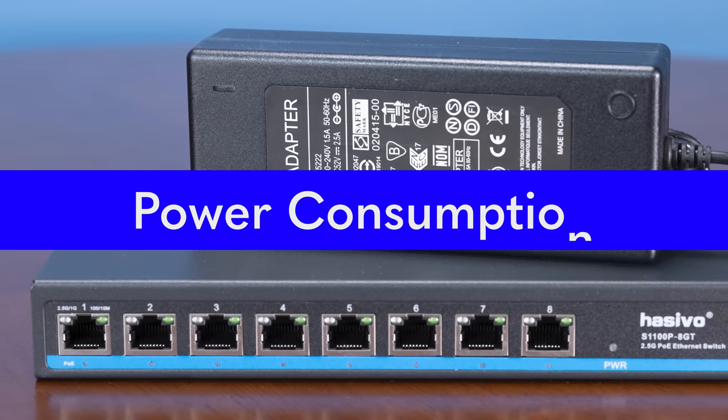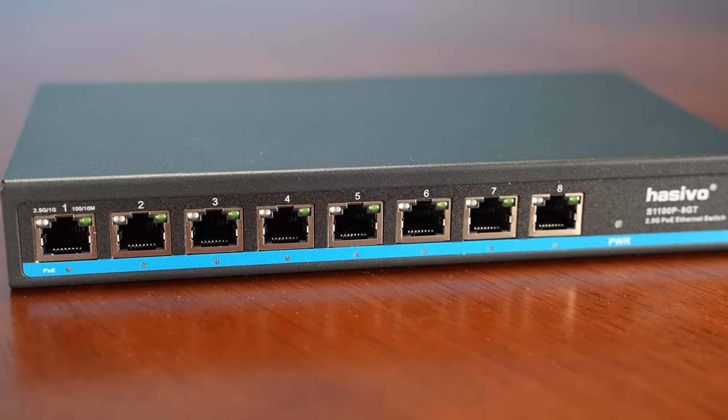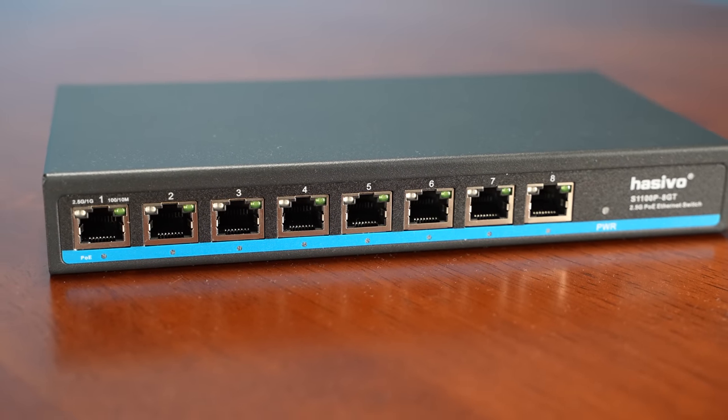In terms of power consumption and noise: in any PoE switch, the vast majority of power used is most likely going to be consumed by the connected devices. The switch itself draws about six and a half watts at idle. When you plug in a two-and-a-half-gig connection, power consumption goes up to around 8.1 watts. I'd estimate roughly one to one-and-a-half watts per additional device connected. For noise, you don't have any — this is a fanless switch — and we didn't hear any coil whine with our unit. No buzzing whatsoever; sample size of one, but still pretty good.